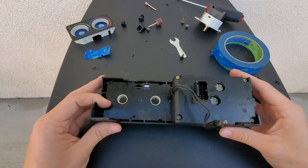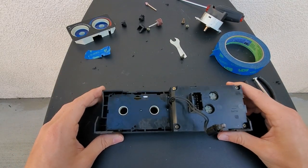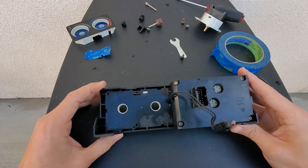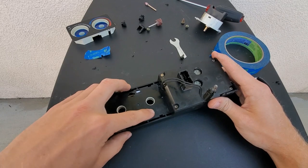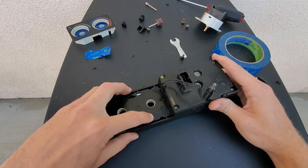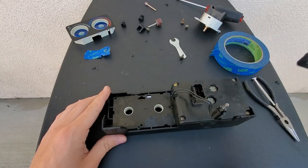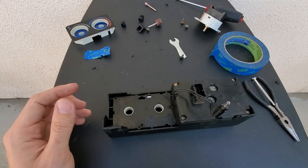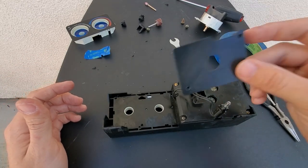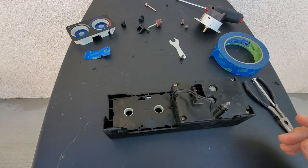I just finished grinding off the studs from mounting the original mixer and removed the fan speed controller here to make things easier. Once you do that, make sure everything is nice and flat — it has to be flush or under-flush with no high spots. If you're not going to include the mounting plate, you can go ahead and glue your original mixer here. Just make sure you take it off your CRX and be careful with the cables.